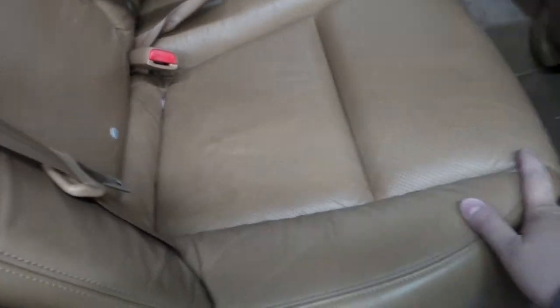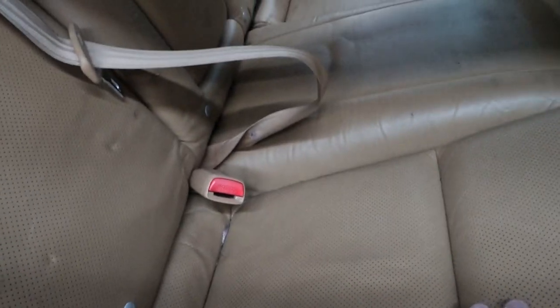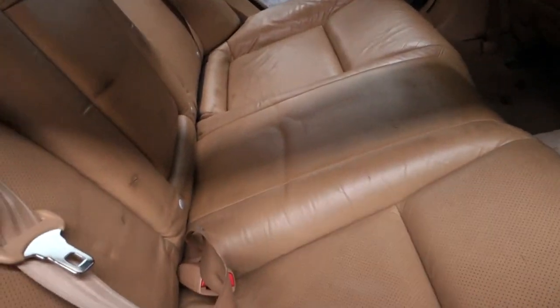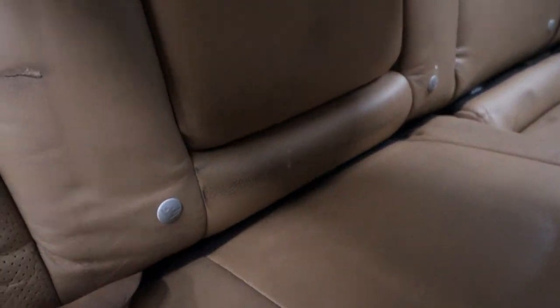When taking the rear seat out, there are little clips underneath — I'll show them in a second. The most important thing is the bolt that goes right here. I can tell this car has been taken apart before because these aren't put together correctly and it's extremely dirty — clean your hands before you start touching stuff. Those clips allow you to raise the seat up, then you can angle it upward to get a view of where that bolt is.